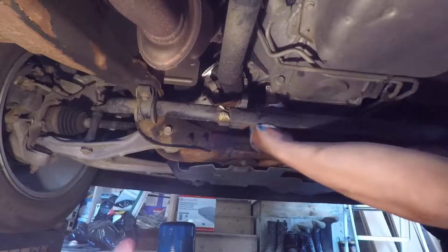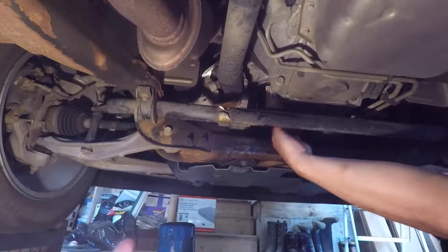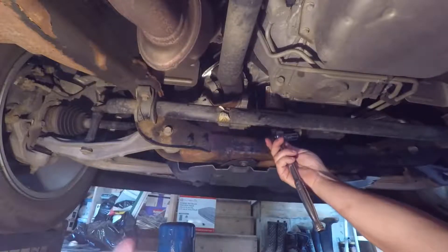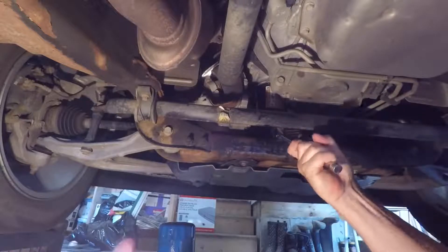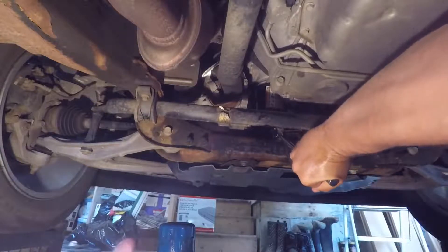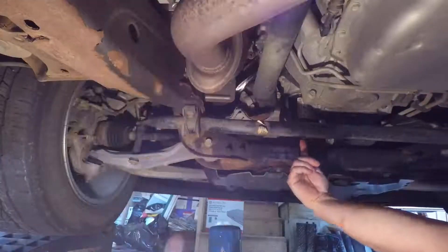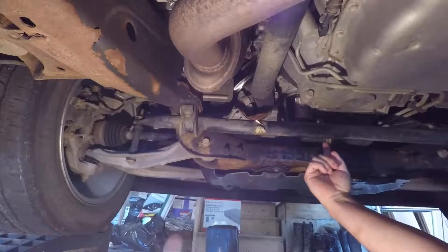You won't be able to tell if it's been leaking, so clean everything once you've got your filter and bolt back in. Make sure you clean your oil pan bolt off really good too. Don't over-tighten it or else it'll break — you could strip it. Oil filter location and oil drain plug on a 2015 Suburban — right there. We've got the new filter on and the plug back in.